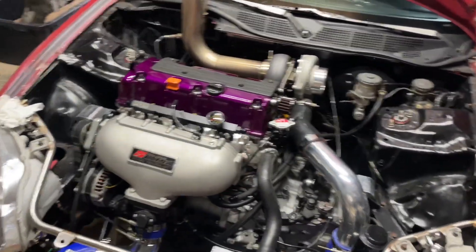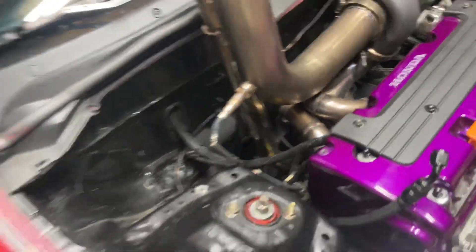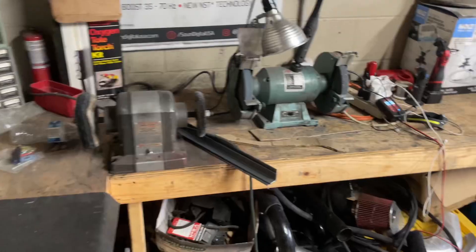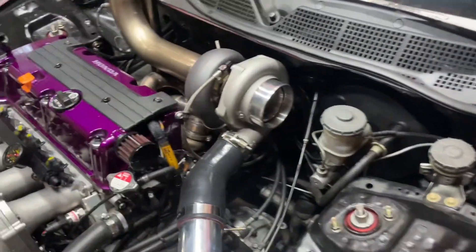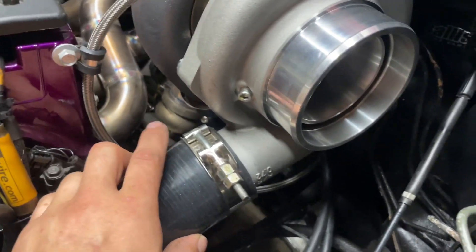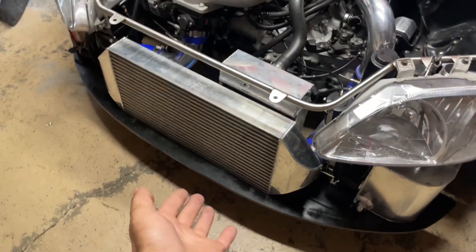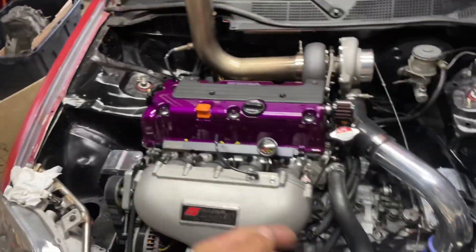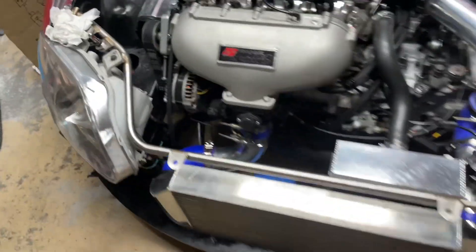Here's the race car build — it's a Pulsar 3584 RS second gen with a top mount manifold from Schmuck Built. Someone local did the uppipe. Skunk 2 intake manifold, and it's got a small wastegate on it right now which I need to change because I'm fighting boost creep. It's only a 44mm gate, and I've got a 60mm that I need to put on. It's got a front mount intercooler, a drag radiator, and right now I'm working on the fuel setup — Magna Fuel 750, inline, dash-eight line.